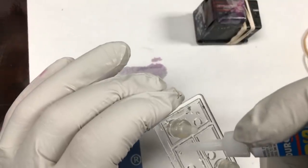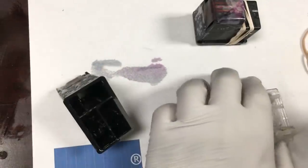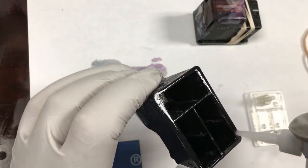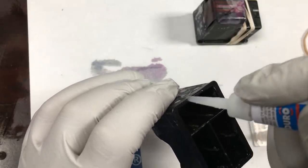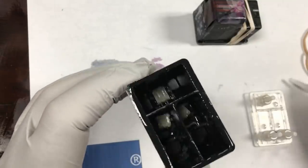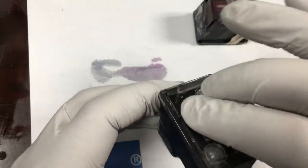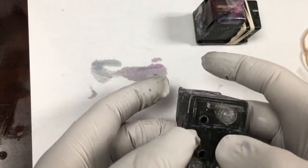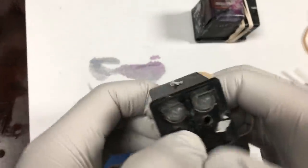We're going to apply a liberal amount of super glue on the cover. For the color one, we fill the center cover and form a letter T. The center one is the one that's most likely to have air leaks. Then we apply a layer of glue on every edge of the cartridge. Make sure you wear gloves while doing this — it's a very sticky situation. Make sure you don't accidentally drop any glue on the air hole, as that will ruin the cartridge.